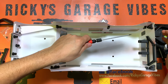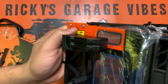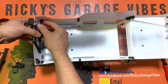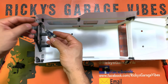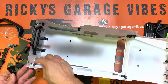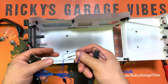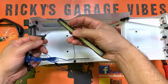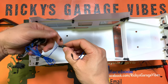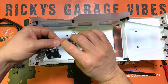Now we're moving on to remove the back tail lights. Each tail light has just one screw at the back — let's pop that out. It's a little tight because of the body mount cage; there's a little notch on the back. Now we've got the headlamps already attached with the light bar. The kit comes with extension plugs that connect all three together — headlamp, light bar, and tail lights.